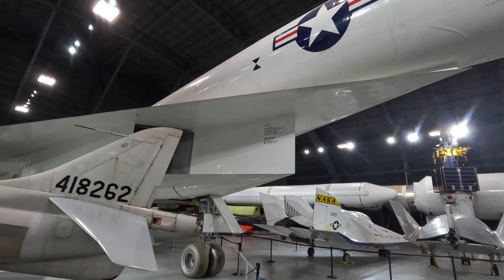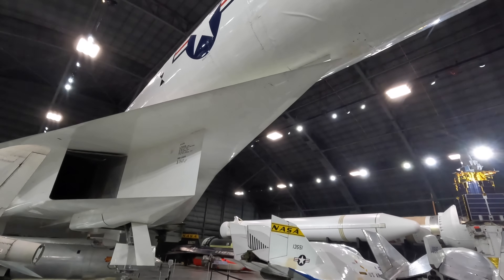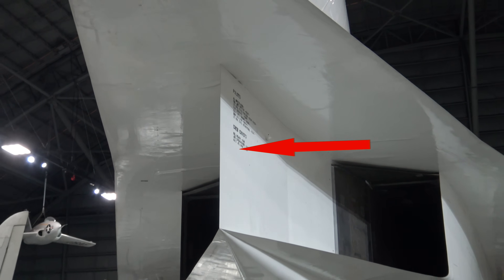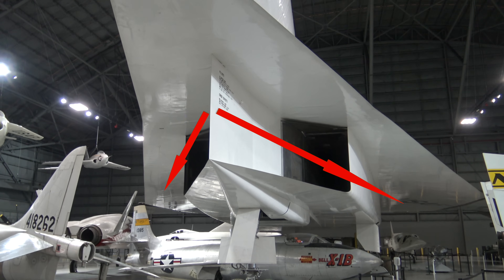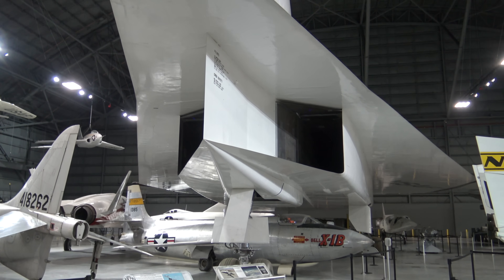Let's walk further back, and I'll explain why the aircraft is this shape. There's a small gap here at the top of the splitter, which essentially removes the boundary layer air, which is otherwise turbulent and reduces engine efficiency. Then directly below that, you've got the main vertical splitter. This creates a shockwave, which is an area of high pressure air extending behind it on both sides of the aircraft. The wing is perfectly located to capture the shockwave, and it generates additional lift.